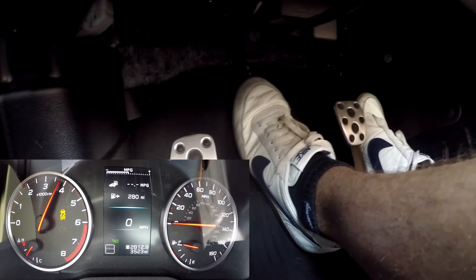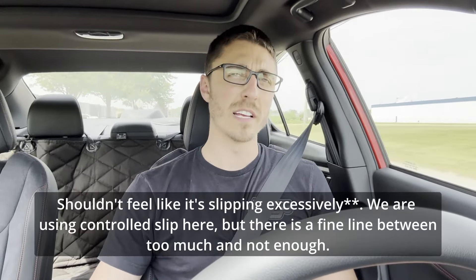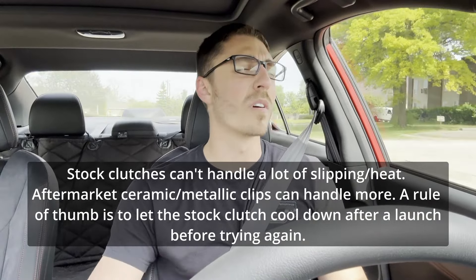That was pretty good. Hopefully you can see in the video of my feet that I let the clutch out a little bit, let the suspension of the car load up, and let the car start moving before I fully released it. It's a perfect balance where you're keeping the turbo spooled up, allowing the suspension to load, and allowing the car to get a little bit of movement. Once you start moving, it's much safer to fully engage the clutch. If you're doing this properly, the clutch shouldn't feel like it's slipping — it should still feel like it has plenty of bite. If you smell an organic burning smell, stop and reassess.